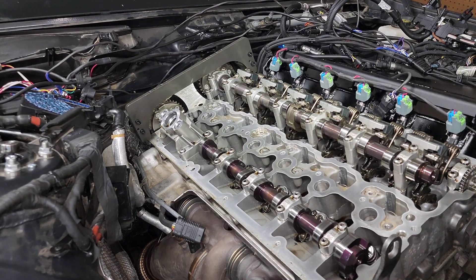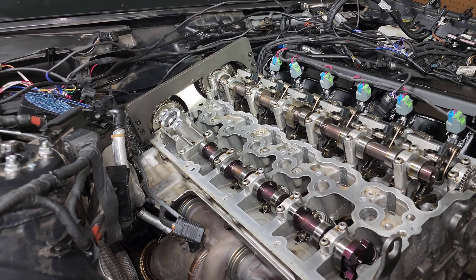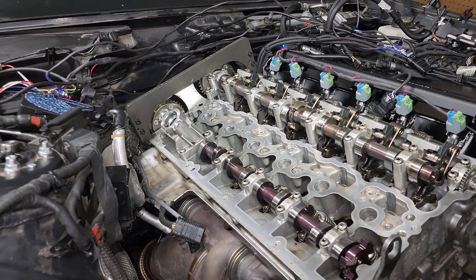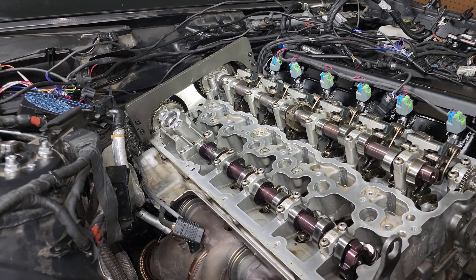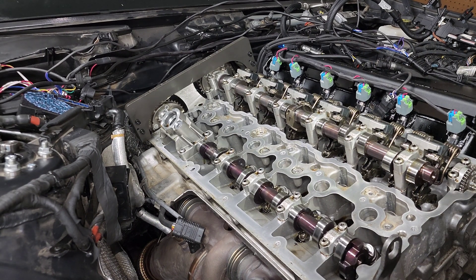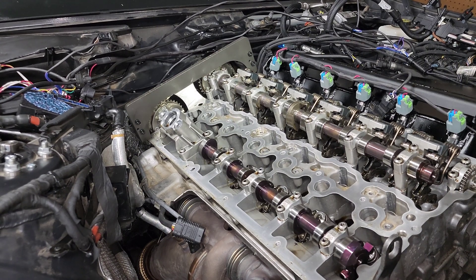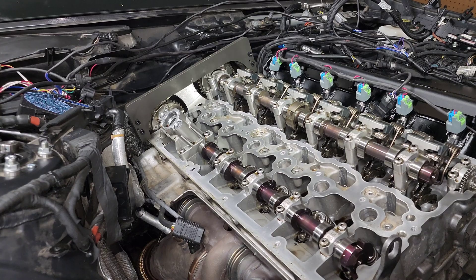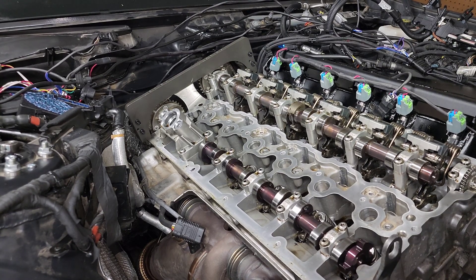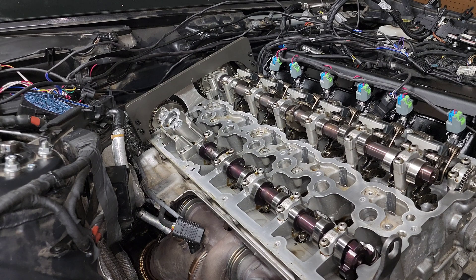This was quite the learning experience, and hopefully it gives you guys a little more guidance on what to pay attention to when setting the timing on your B58 engine. Double-check your work, especially if you have any counterclockwise rotation on the crank pulley. Turn over your engine at least twice and double-check the timing relationship between your cam and crank to make sure everything lines up. Use your fake tensioner to put as much tension as possible on the timing chain guides. In general, this process is pretty simple when you have the right tools — you just need that extra care to do it correctly the first time. Thanks for watching, and if you have any questions or comments, leave them down below.